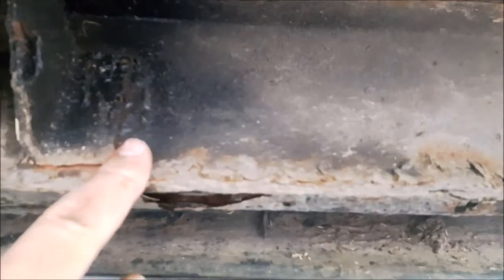Right, underneath, where are we? So you can see the sills. I've been along here with a hammer, predictably. The sills are not tied the whole length. This one's better. There's not too many problems on this one. There's a little bit of fat up here on the inner sill. When it comes to the inner sill area, it's actually pretty good. You're looking up on the line where it joins the floor. There's no bubbling up there at all. This is all nicely done. I'll replace this piece here on the inner sill.